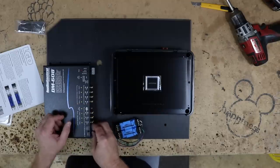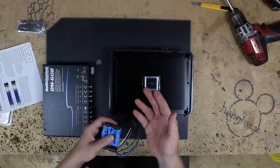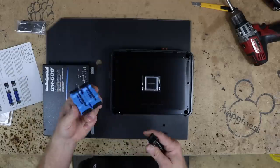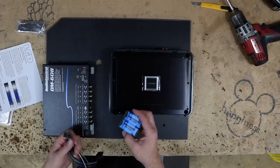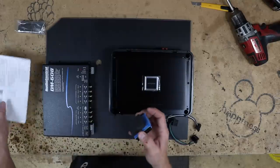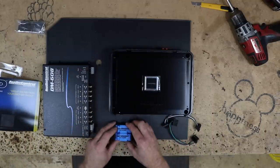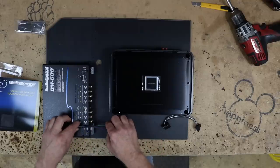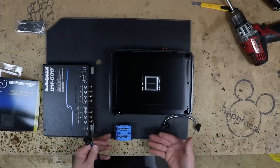The nice thing about the type of connections that these have is that if you've already put in an LC8i, 6i, 7i, LCQ1, or the DEQ, you can just go ahead and plug these in with these jumpers. So you can always add these after the fact if you do notice some form of high frequency distortion. Now they come with this block of foam attached to it. That's what they're attached to here. We're gonna go ahead and put some more double-sided tape on them so that we can stick them right here. We're gonna go ahead and unscrew this end and add in that so that we can have these hooked up.